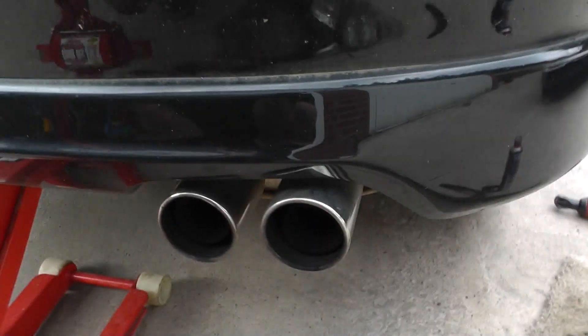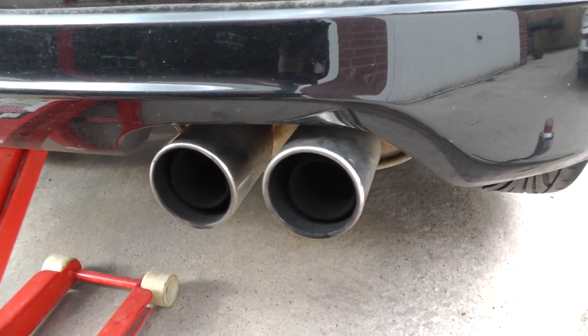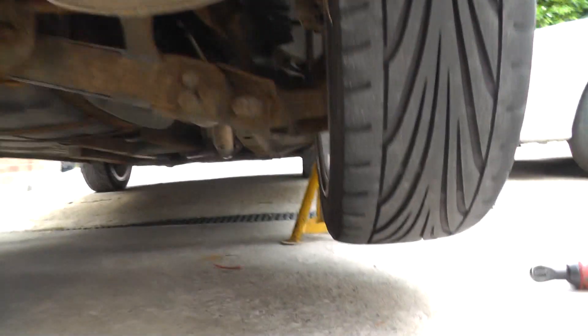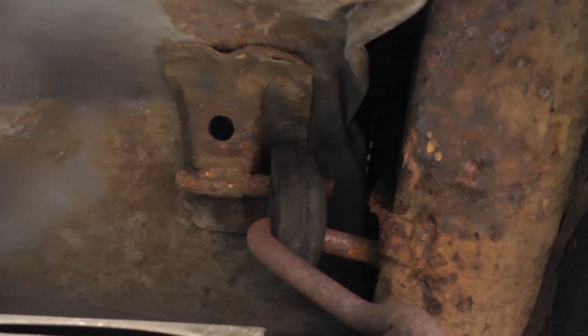I'm just going to drop this back box off because the noise from it is a bit suppressed — it's not really sporty sounding — and I'm going to try this one again. It's very simple to do. All you need to do is come underneath here, put the car on axle stands and jack it up using the tow hitch. Then here you've just got two bolts which are spring bolts — undo them.